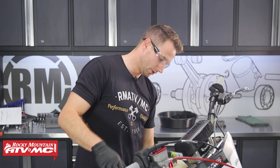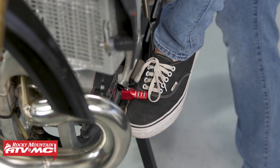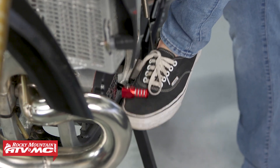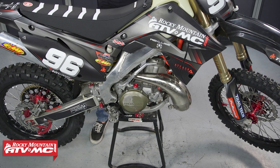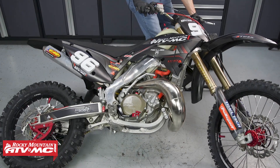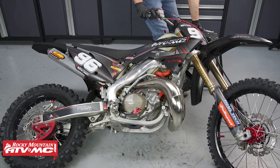After that we will turn the gas off and then shift the bike into fifth gear. If you do plan on changing your oil right now, go ahead and drain it out and then you'll refill it once you have your clutch all put back together. If you are draining your oil you can do this process with the bike on the stand, but if you just put fresh transmission oil in there then you can lean the bike over like we're going to do.